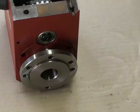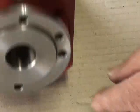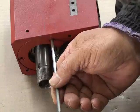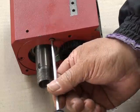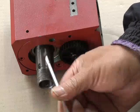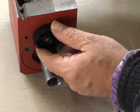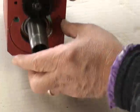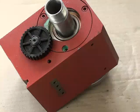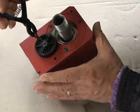So now we have loosened the bearing cover by removing the bolts on this side. Now take the bearing cover off the other side. At this stage you'll notice we need to take this gear off, so for that we need our special circlip pliers.